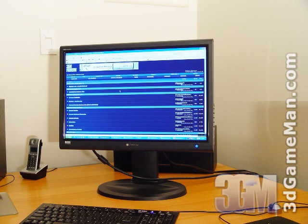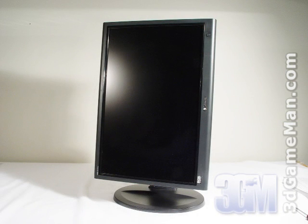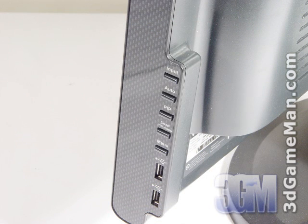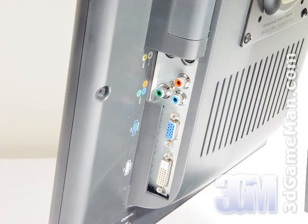Now, the display. There are two options: the older but very affordable CRT, or the newer LCD. CRT, or cathode ray tube, is dated technology but does offer excellent color, especially in dark gaming environments. The disadvantage is CRTs cause eye strain and are very heavy, so I would rule them out and go with a liquid crystal display. There are two different formats — widescreen and full screen. Considering widescreen LCDs are now affordable, I would recommend going that route. When selecting a widescreen LCD, get one with a response time of 8 milliseconds or better to avoid ghosting, and be sure it has a DVI connection. I'm selecting the Gateway 21 inch widescreen high definition LCD.